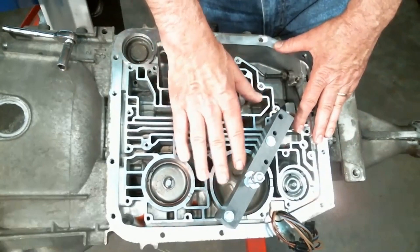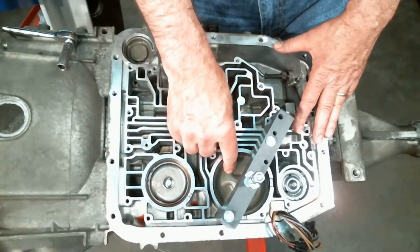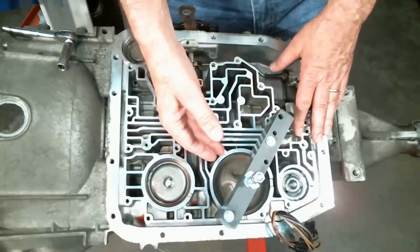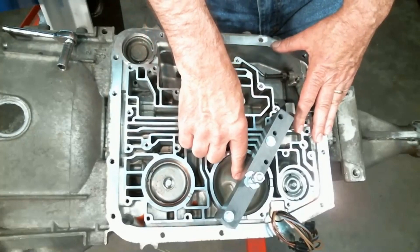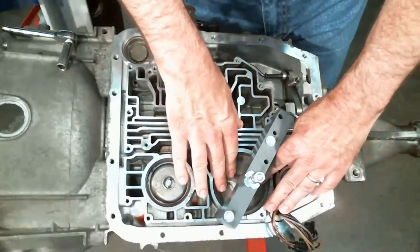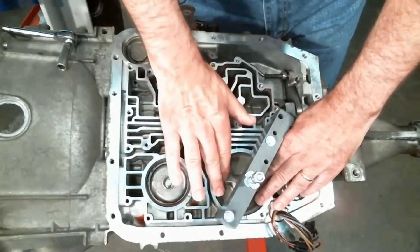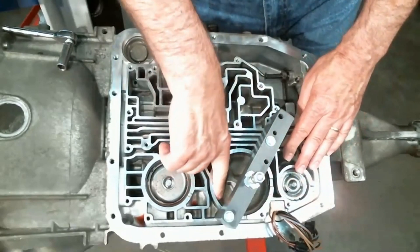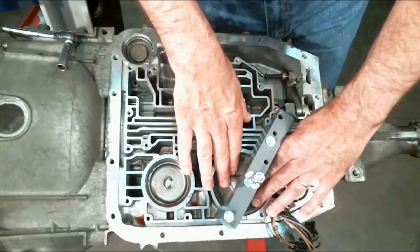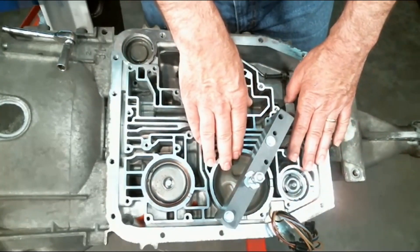This servo, however, you won't have the problem with the band. When you take the servo out and put your new servo in, it will index the lug because this band is kind of captured in this area — it's also a rigid type band. So the lug will always be over the hole. Also, when you're going down with the servo cover it's going to walk around, so you're going to have to keep the cover located in the center as you run the pinch bolt down. Otherwise the seal on that cover might get hung up in the snap ring groove. Get it centered up, lower it down, get the cover below the snap ring groove, and then install the snap ring.